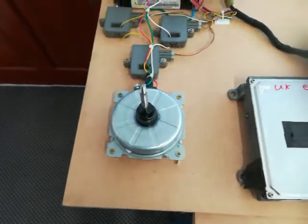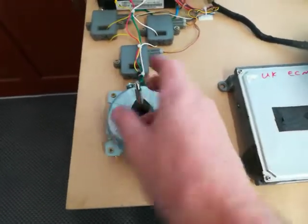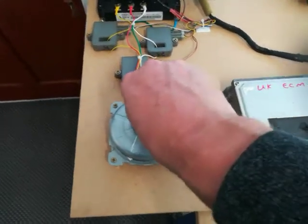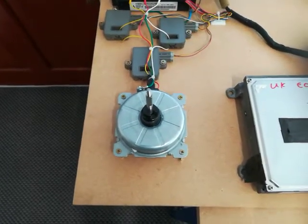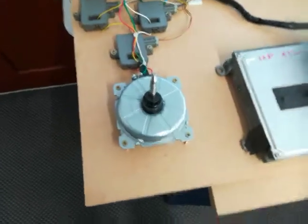It's just hacked down there. It's got no commutation sensors, so I'll have to do something about that — make some sort of fake commutation sensors to feed the MCM. But for the IMA start cycle it doesn't need the commutation sensors initially, because obviously the motor's not turning when you first press the start button, and the IMA doesn't need that to fire up the motor initially. So if we can get it to do that, we'll at least know that bit's working.